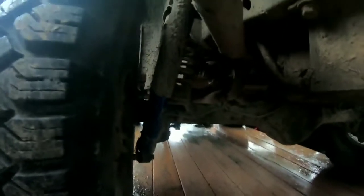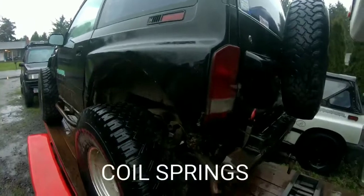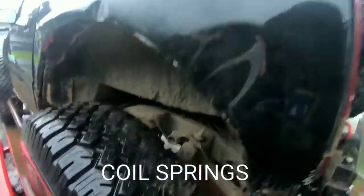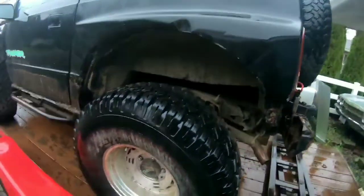Still didn't get me what I needed, so it also has four-door springs off of a '96 four-door Sidekick. That helped give another inch or so, and then those shocks are the E150 or F150 shocks. The first time I ran it with the 35s I had the stock leaf springs in there and it rubbed like crazy, and when it flexed the tires fell out. So we went ahead and went to the four-door springs and I have not had any issues whatsoever.